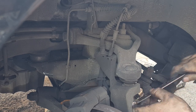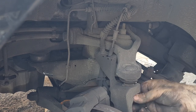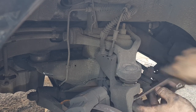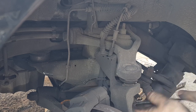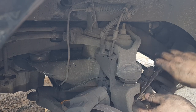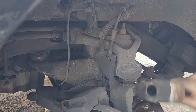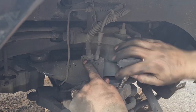This is an 18mm nut on this ball joint, which is a bit of a random size. Everything on these cabs is agricultural — it's all really big stuff. The wheel nuts are 27mm and there are six of them. The amount of pounding they go through in London means they need to be pretty beefy. Right, give that a clonk and hopefully that will pop out — and there we go, that's that out.